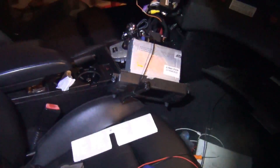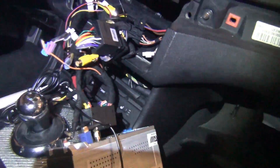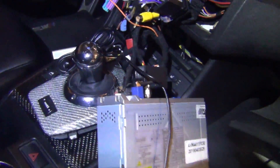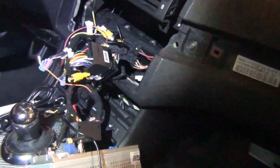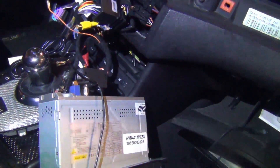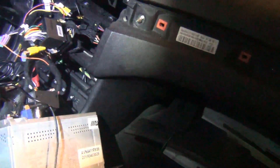This one really gave me a run for my money. I pulled out the aftermarket radio and found a big spaghetti of wires — GPS sensors, USB, antenna, microphone, and a bus communication translator. I plugged all that back and the wake-up was still there. I pulled the IHKA heater control panel out — wake-up still there. I disconnected the TCU — wake-up still there. I noticed it happens every 10 minutes: a 200 milliamp wake-up.